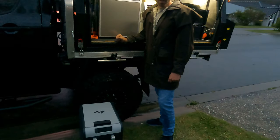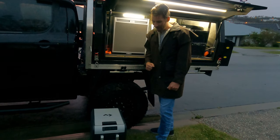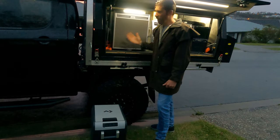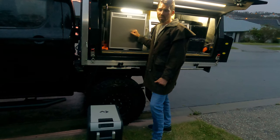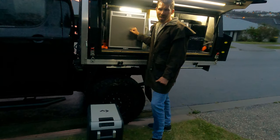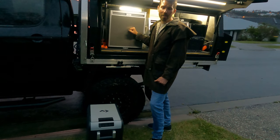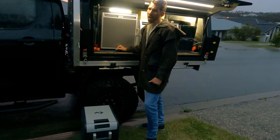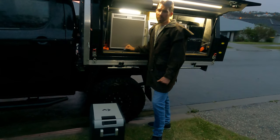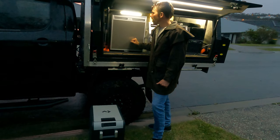I also got the little 25-litre, basically just to use as a freezer — only when we actually need it. On shorter trips it doesn't live in the car, so again cutting down on weight and current draw, and it's purely just a freezer. Going into power consumption: I ran it for two days straight in 30-degree temperature and it only used under 20% of my 120 amp-hour battery. I then ran it from about 9:30 at night till 11 the next day and it averaged 0.5 of an amp draw. They are incredibly efficient, incredibly good fridges.